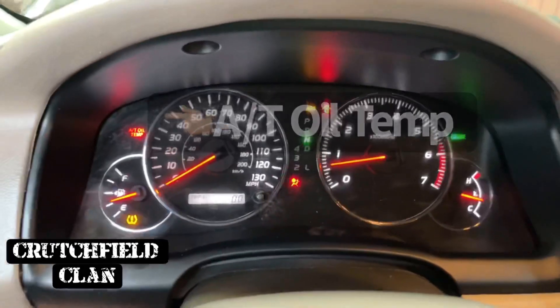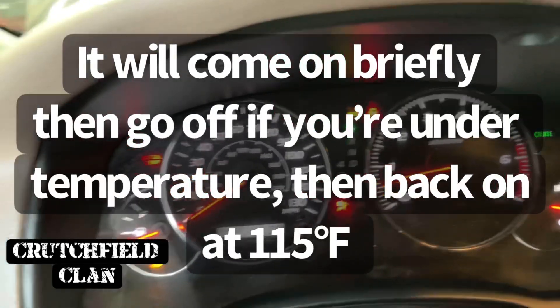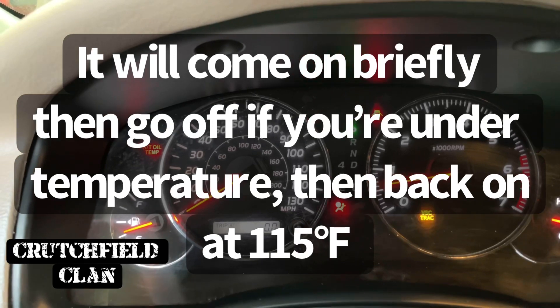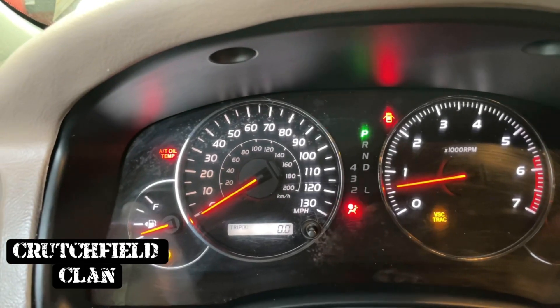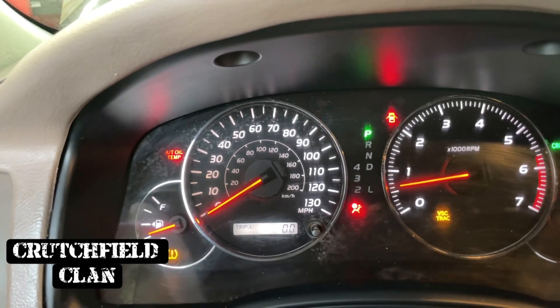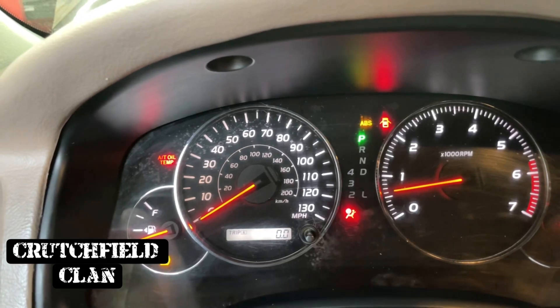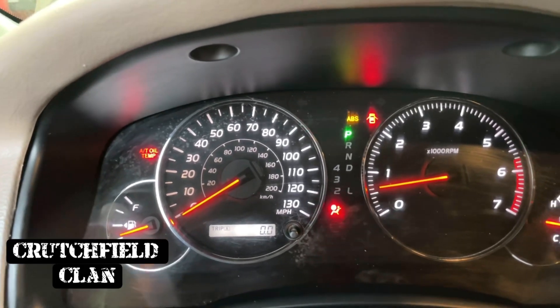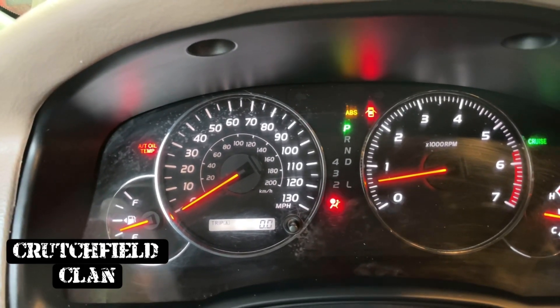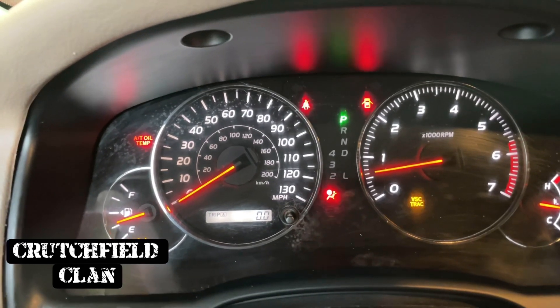Just had to go from neutral to drive a little faster. Put it in park. It is illuminated, which means the temperature is where it needs to be. We've already been running, so now I can go into the vehicle and pop the overflow check valve and let that transmission fluid come out.